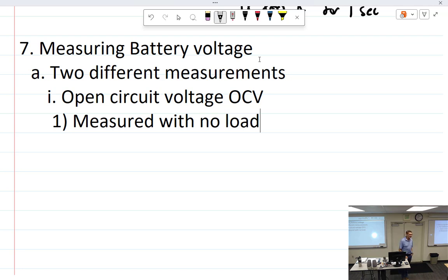You get in the car, turn off the lights, and try to start it. It goes click. That's a solenoid rattling. So if you were to get out at that point, take out your trusty voltmeter, put it on your battery, how many volts would you have? 12. Sweet. But wait a minute, how many volts do you need to start your car? 12. So why didn't it start? There's a reason why. Current is low. It's a liar, because at that point it's open circuit voltage. It lies to you, tells you it's fine. But then you turn on your headlights and try it again, and you get brown headlights and 4. Why? Because now you did it with a closed circuit voltage, and it's like, all right, I was lying.